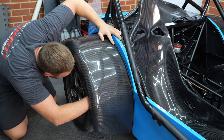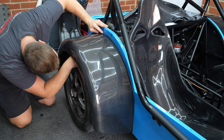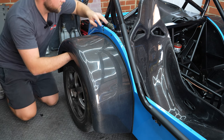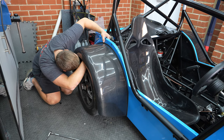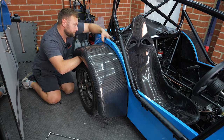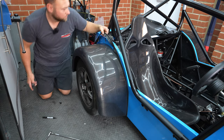That'll be a job done. The best thing is to mark one at a time - if you can hold it in and it stays nice and down in the right place, then mark a few. But you can just do one at a time if you want. Because Rob's pushed it too far in there at the top, it just kind of dips down if you're not careful, because the arch is a bit of a weird shape and doesn't always get a hundred percent flush fit with the body. So you may find that in some places there is a gap - but don't worry, because the car body will pull out a tiny bit, the arch will pull in a tiny bit, and the rubber will fill that void. Then we just need to address those horribly high offset wheels. Let's get that done and then we'll show you the finished article.